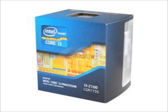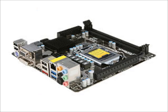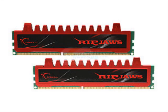For the motherboard, we have an ASRock H77M-ITX. If you want to upgrade this to Ivy Bridge, you have that ability. It's the H77 chipset — it's an improvement over H67. But if you want to save a little money, find an ITX board that uses H67 — feel free. For the RAM, we have 4 gigs of G-Skill DDR3 running at 1600 megahertz. We don't really need more than that, so it'll do great for $30.